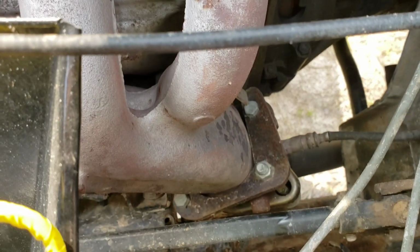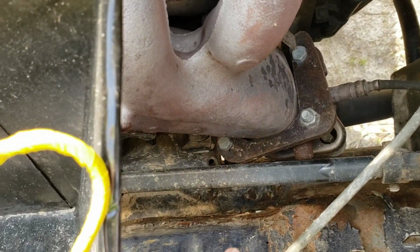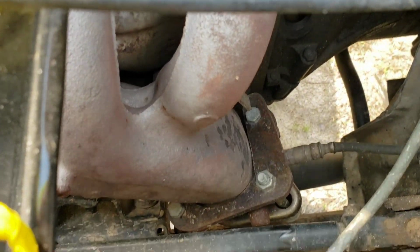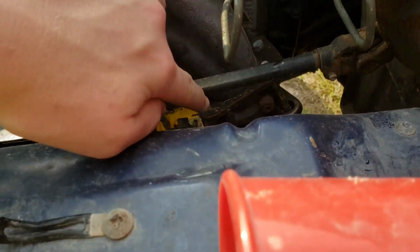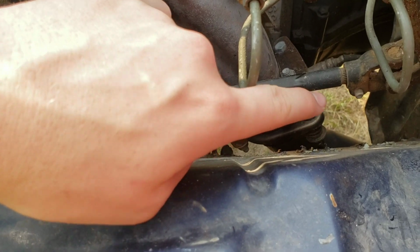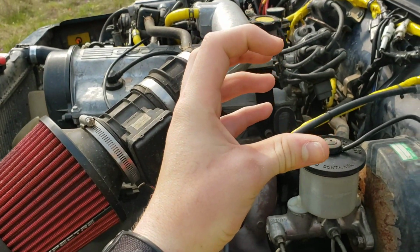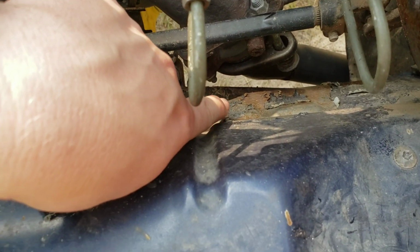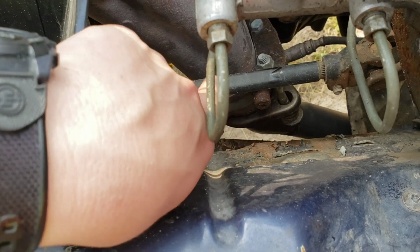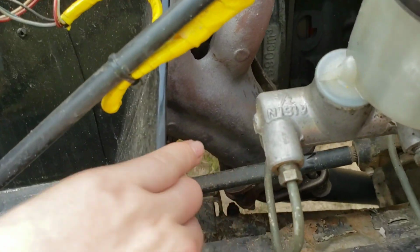So the exhaust is actually a very big problem. You see how close it is? There's a frame right next to it that it will bump into unless you build a custom exhaust bracket. There are 2 C's here, it's hard to show, on each side where we rotated the bracket 90 degrees off the frame to get clearance, because it would constantly hit on the frame. That's a big concern for a lot of people, and it should be, because that was decently challenging to make.